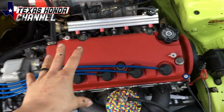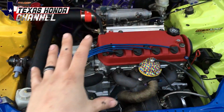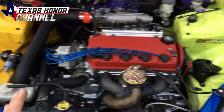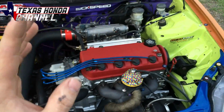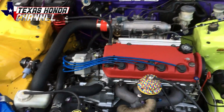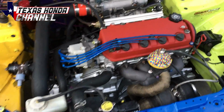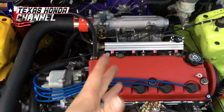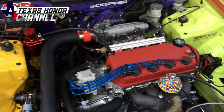But so there's a boost leak coming through the head gasket. If you daily drive it normally, it doesn't leak because you're not hitting boost. But this is a Felpro head gasket from O'Reilly's. They're rated for right around 30 psi. So as soon as we hit 30, we had some issues. The ARP head studs weren't lifting the head or having any issues. It's just that the head gasket can't handle it.